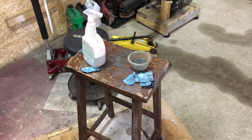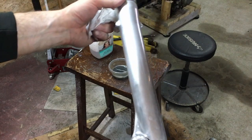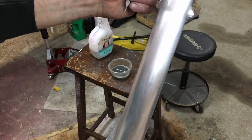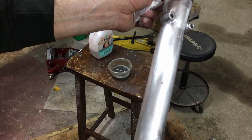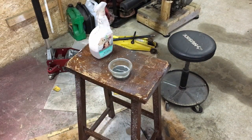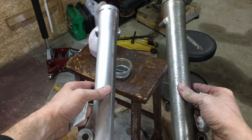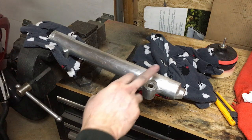At this point we've just finished doing 1000 grit. There are still some light marks on it but not really bad. I'm going to hit this with 2000 and then come back for a look just before polishing. Here's a quick side-by-side — left side just after 1000, right side still not done. You can see they're starting to come together nicely.